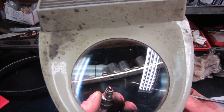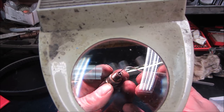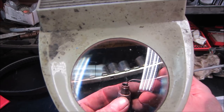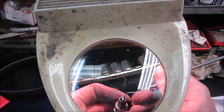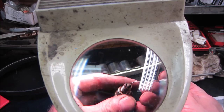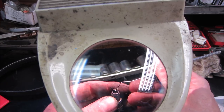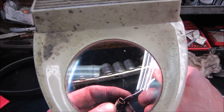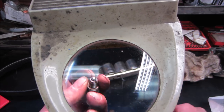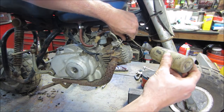I started looking at the plug and I was digging at it with a probe, and it definitely is pushing up some sludge from around it. Sometimes what happens — a plug will have spark in a regular atmosphere, but when it goes under compression it won't spark. I don't have another one of these, so I'm going to take a little time and clean out around inside there and give that guy a second chance. Let's try it again and put just a little bit of fuel in it.